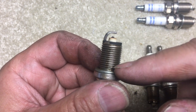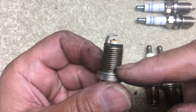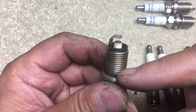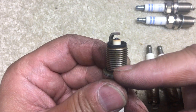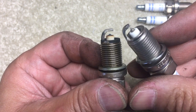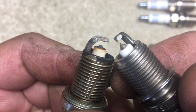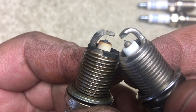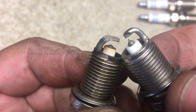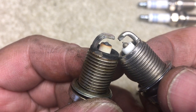At 6,500 miles the tip just burned down. Even if I didn't know the mileage on these plugs, seeing this I would immediately replace them. I did get a P0300 random misfire code. I'm not sure how much worse it could get or whether it could eventually burn a hole in the cylinder head. If you put in very cheap Denso or NGK plugs, revisit them and check before the car stalls and leaves you stranded. Here again is the difference in the tips — this is the fake Denso and this is what a normal iridium tip should look like.